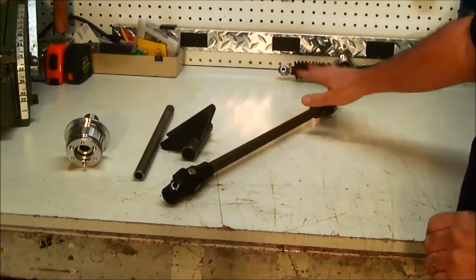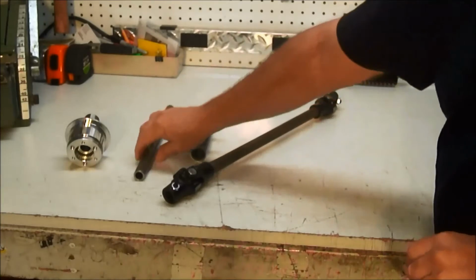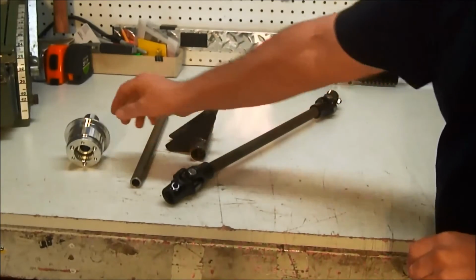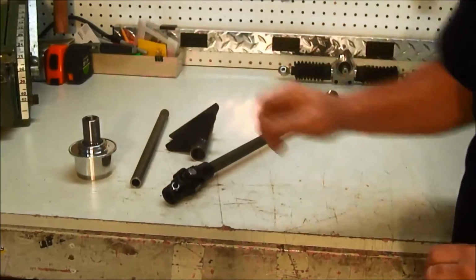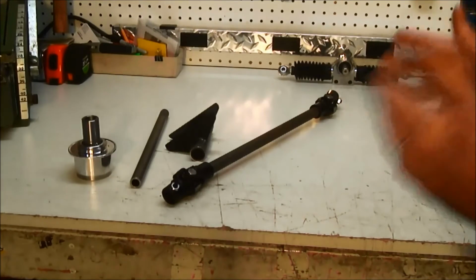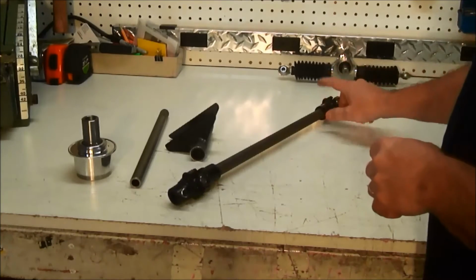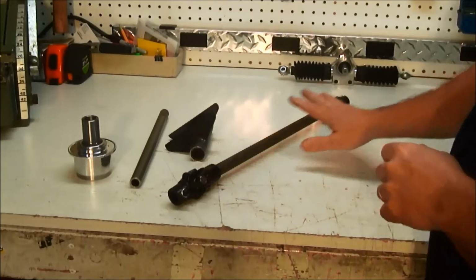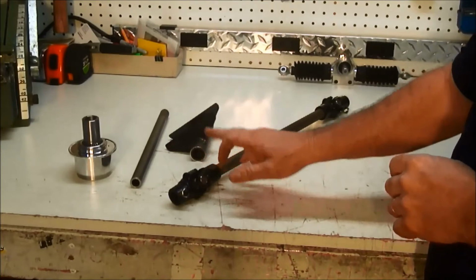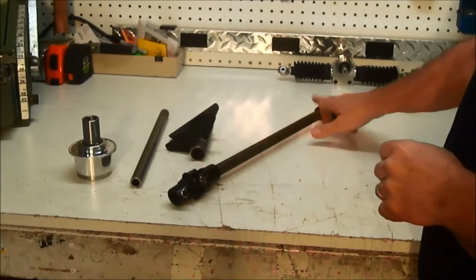And what we suggest is 2 U-joints, a bearing support for the steering shaft up by the steering wheel, and also a quick disconnect. Just those simple items will get this from the center of the car over to the driver's side of the car. Basically you just need the 2 U-joints. It could be any combination you want, but we suggest maybe a 3/4 weld on each end.